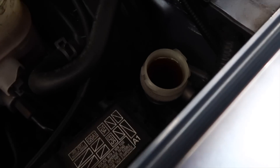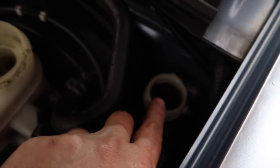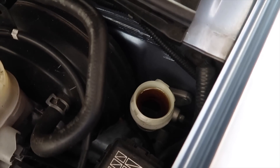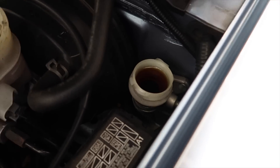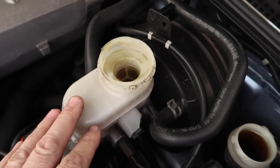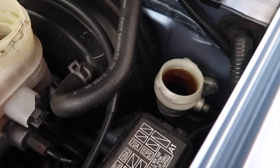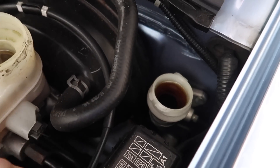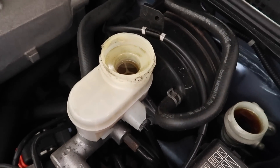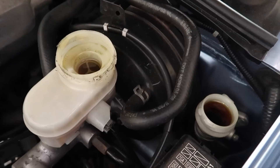I'm not going to bore you with the oil change — you've seen that before. This is something I can't stress enough, and I'm not telling you to come to LHT to get it done — I'm just telling you to do it. Clutch fluid right here, the little reservoir — this gets really dirty and contaminated. From hot and cold cycles, it condenses, pulls in moisture, and forms almost a gritty material. Same on the brakes. Over time it will cause more damage. We replace so many clutch master cylinders and they're just not that fun to do — it's a waste of money if you can prevent it. Stay on top of this. I'd change it every year, and flush the brake fluid every one to two years. Unless you track it — then flush it after every track day. This gets overlooked and I want to bring it to your attention.